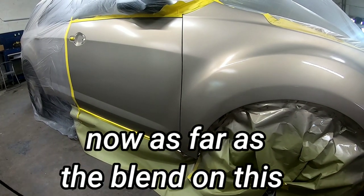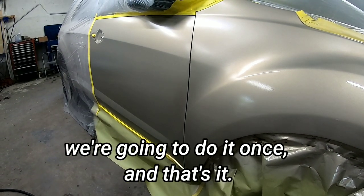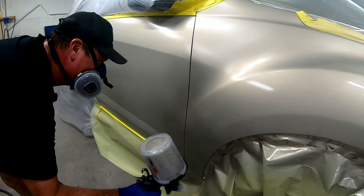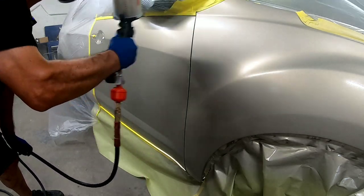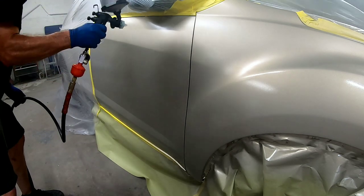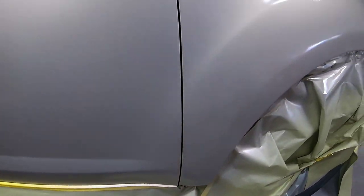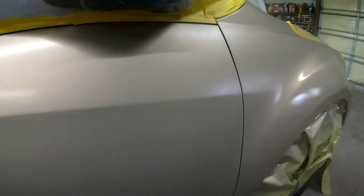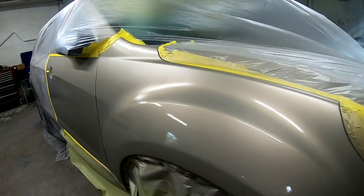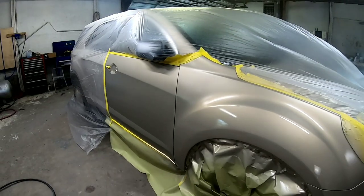As far as the blend on this, we're going to do it while it's wet — we're going to do it once, and that's it. I'm going to put a heavy coat on the first four to six inches of that door, and then as I gradually go out into that door I'm going to pull back a little bit on my blend and dust coat it on. The blend is done — nothing fancy. I don't want to get any piling out into this panel so you've got to keep it wet. It's 100 degrees today so it's going to be tough, but we blended right here and put one coat across the top. Now it's time to clear coat.